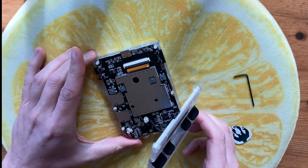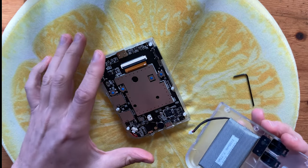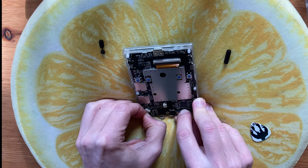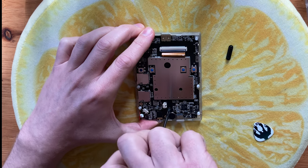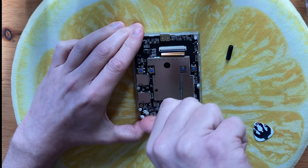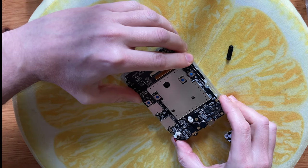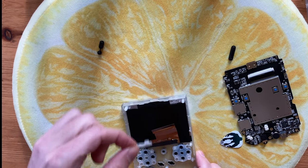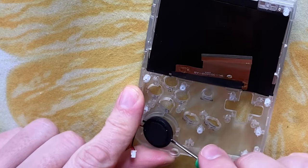And hey presto, we're open. We'll need to disconnect the battery to pull off the back of the case. We can then remove the buttons on the side, then unplug the speaker cable. The board is held into the shell by 6 screws — for this you can use a small posi driver. The board can now be pulled out slightly, but the display is still connected. We can remove the cable by pulling back on the plastic tab and feed it through. We can now remove all the buttons and the membranes.